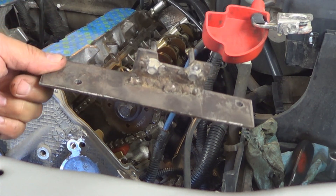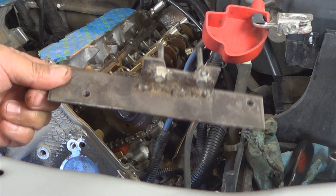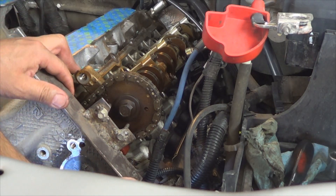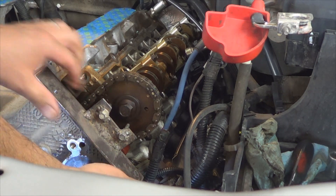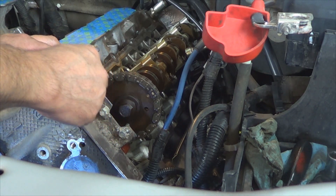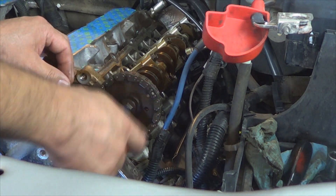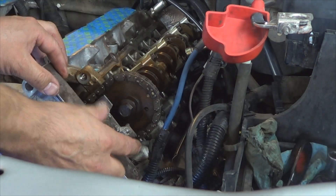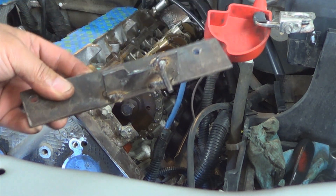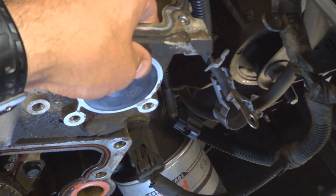I made a custom tool when I was doing a previous job on a Dodge Ram pickup that also had a 4.7. It slides onto the camshaft sprocket and allows me to keep the alignment. I'll install it after I remove the chain — right now I'm just showing how this tool keeps the alignment on this camshaft. I also made one for the other side. Pushing from the inside, remove this plug.